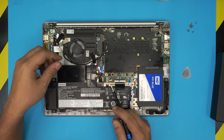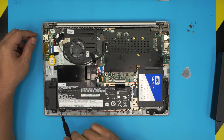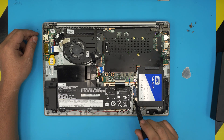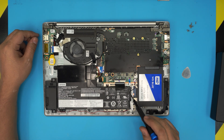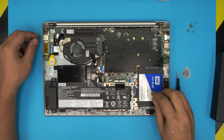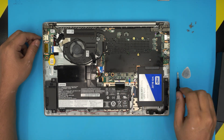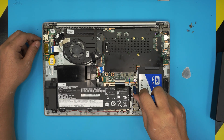To fully remove the battery, you have to remove this screw, this one here, this one over here, and the one over here. When you remove it, the audio cable is tangled around here, so untangle that cable and put it to one side, then go ahead and remove all the screws.